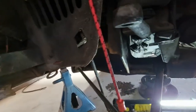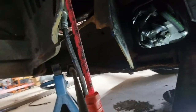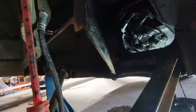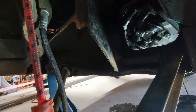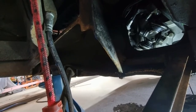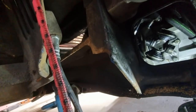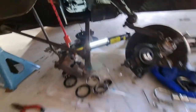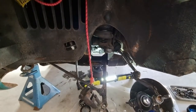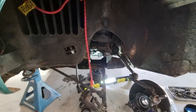Speedo cable is in on this end. I ended up taking the splined part of the drive shaft that goes onto the uni joint — that gave me extra clearance to get in there. But that was trickier than getting it undone because it didn't want to go on. Every millimetre was a bit of a struggle, but it's on.